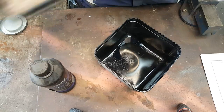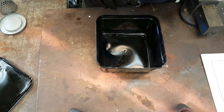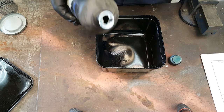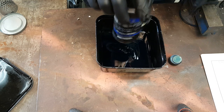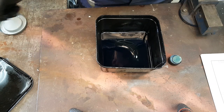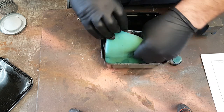There you go. Nothing left in there. Right. Okay, so in goes the oil. This is a couple of weeks old. We were grinding a trailer recently, that's why it's covered in dust. And just pour in, basically half a bottle's normal, but this is about gone now. Okay, and just get your air filter and knead in that oil.